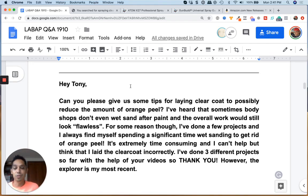I would also go for the two-coat clear coat method. Instead of doing a tack coat and then two heavy coats, try putting it on heavy from the first coat — a medium-heavy. Just lay it on like it's your last coat. Let it flash for 30 to 35 minutes or so, then lay your second coat, and it should look good.